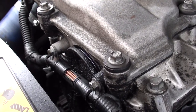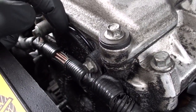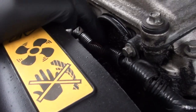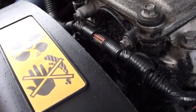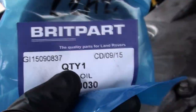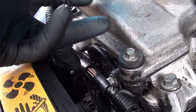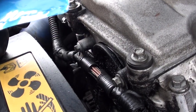You might better see what the problem was — this little blanking plate for the cam is obviously flapping about and letting a bit of oil out. I'm hoping I'll be able to pop it out and stick a new one in, because I have a new one in my pocket. It's a pattern part but it doesn't matter, I'm sure it'll fit. I'm gonna undo those two bolts to move that bit of wiring loom out of the way and then pop that out and put this new one on.